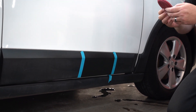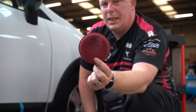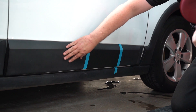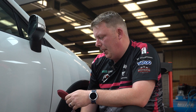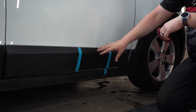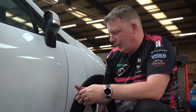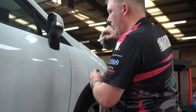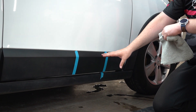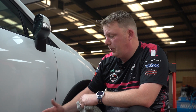I'll show you really closely. Because this exterior trim is textured, unless you've gone to the trouble of using a brush to scrub it during your prep stages, there will be an element of dirt still in the texture of the plastic. So the abrasive in the Cherry Glaze just helps to lift that, clears the pores, and then gives you a nice smooth surface to work on.